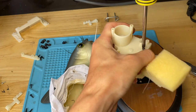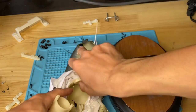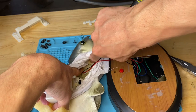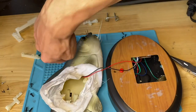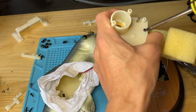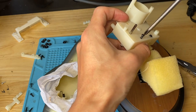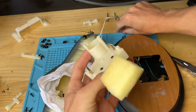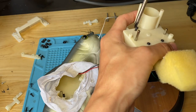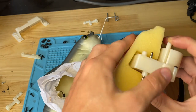Also, if your fish's mouth isn't working too, then before you reinstall, go up here and replace that gear right there. You basically have to go on the other side, take the motor out, remove the foam, take the motor out, and place the gear on it — same drill as the head and tail, just a different motor. My fish's mouth is not split so we're not going to be doing that.